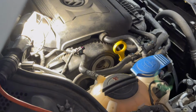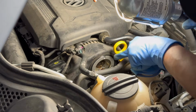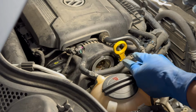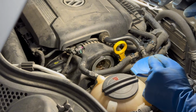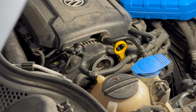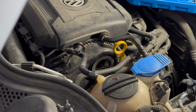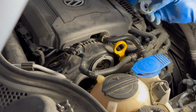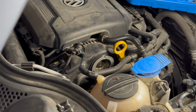Alright folks, we got our magnet off now. As you guys can see, shine some light here. That's the control valve over there. I'm going to undo it. To undo it is a reversal. It's a reverse thread, so righty loosey and lefty tighty. So we're going to be using our tool that we got recently. It's a timing chain tool here that I have. Basically, I can find the one that fits the size there. There's two prongs that would undo that thing. So let me do that and I'll show you guys when it's done.